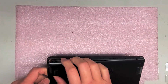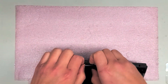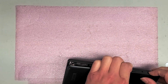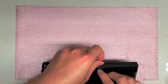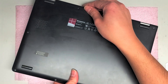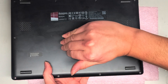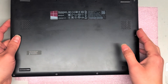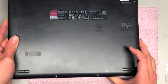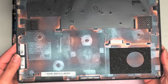Let's see if I can do it with this model. These clips seem to be kind of stuck, so I might have to use my metal pry tool. This section here on the side towards the back is stuck pretty strong. What I did is I put pressure on the middle so that it flexes the cover and pulls the clip inwards towards the center. We're going to try that on this side too. And there we go — we got the cover off.